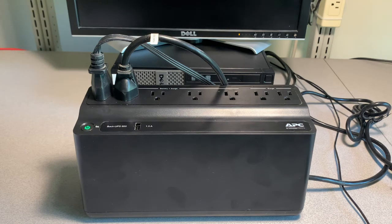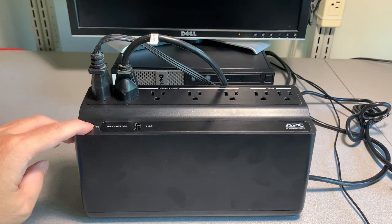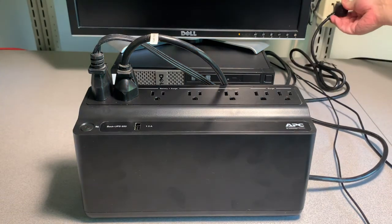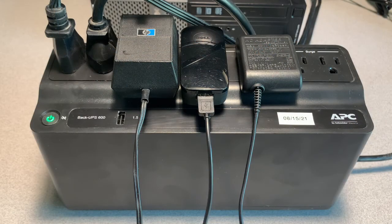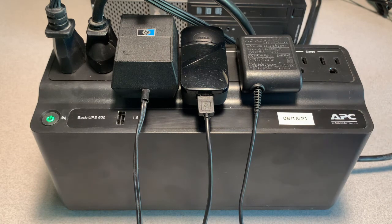To take advantage of quick mute mode, just hit the power button for less than two seconds. Here's an example of how you can use larger power supplies with this particular UPS, which is really nice given the staggered outlet layout. One final tip: I usually like to put the date that the unit was placed into production so I have an idea of when the batteries need to be replaced.